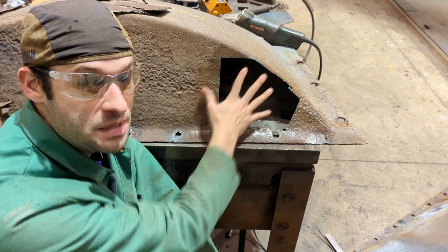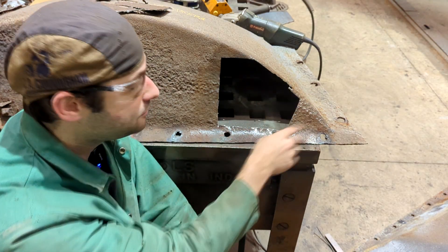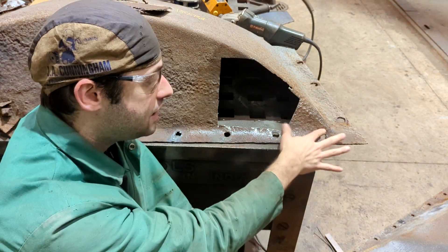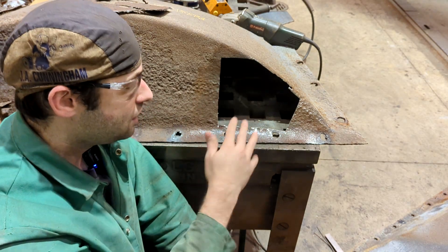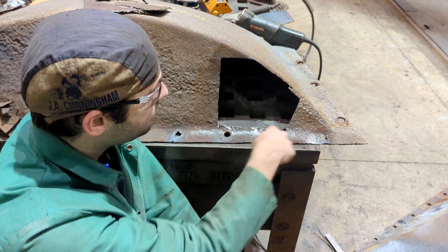I don't really plan on rolling the piece of metal I'm going to put in here — it's just going to be flat and I'll hit it to what's left. I also drew a line further out but I'm not going to cut into that because the metal is still good. When I do any kind of work like this, I keep as much original metal as possible because it's just more work to cut out a bigger piece. So that's where we're left with this — I'm going to clean this up and keep going.